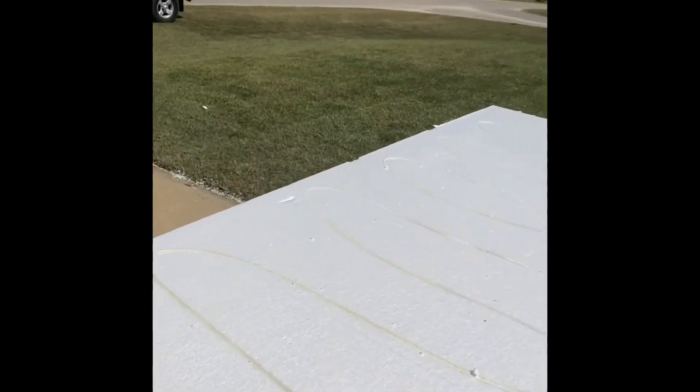As you can see underneath the trailer, it's got steel girder and half inch plywood construction. What I'm doing is measuring between girder to girder and getting it down to as close as possible so that it's a tight fit. Then once we get it cut to fit, I'm using Liquid Nails extreme heavy duty exterior — basically glue — putting it on so that there's maximum contact. Then lastly, to provide mechanical adhesion also, we're using number eight, one and a quarter inch exterior wood screws.